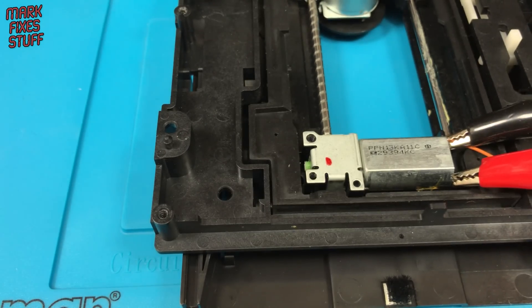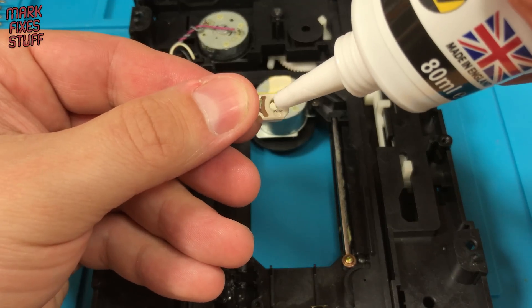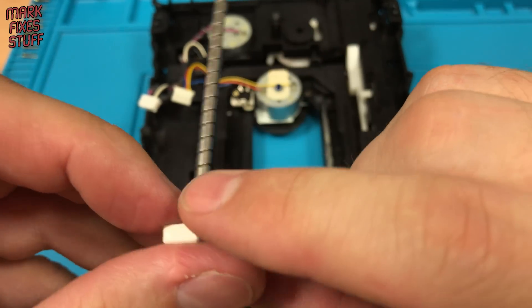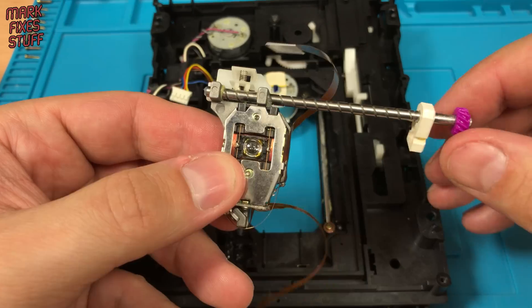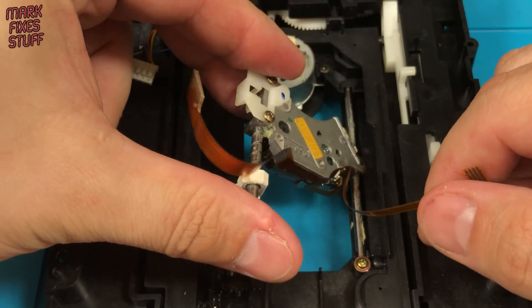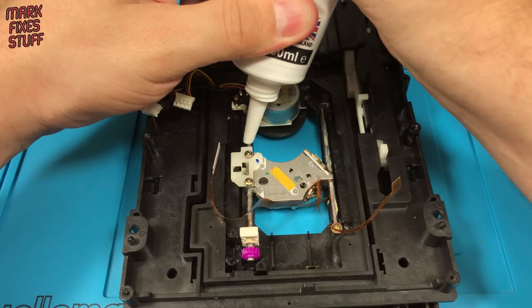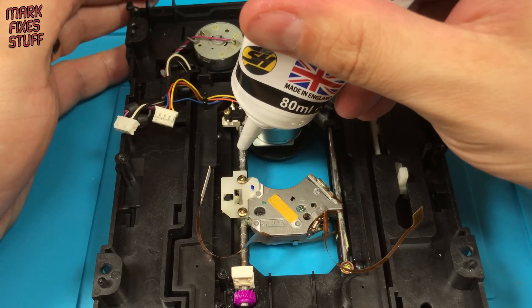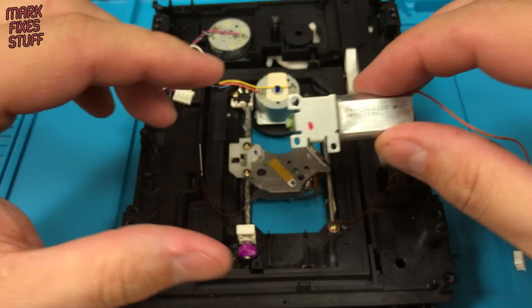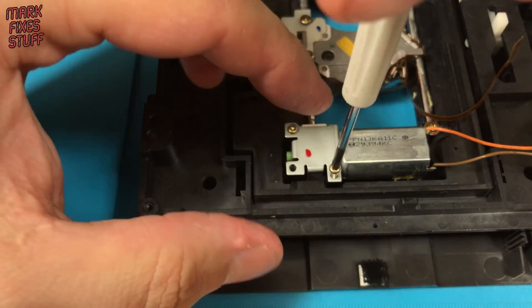Time to put the machine back together properly. I like to grease any parts that are subject to any kind of movement. The blob on the end of the shaft will nicely lubricate the socket. Threading the laser assembly back on, then clipping the assembly onto the guide rail. We push the drive shaft into position. A little more lovely lube. And put the motor back into place. When you put these screws back into the case cover, don't over-tighten because this can cause problems.